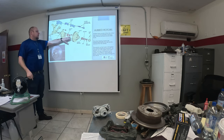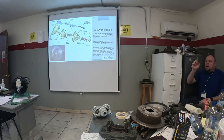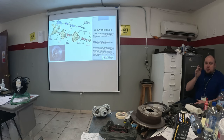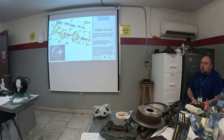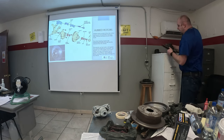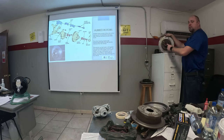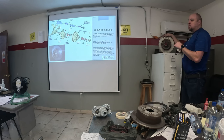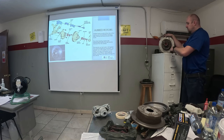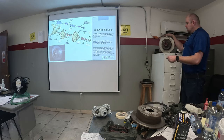Then you take it to the parts washer, remove all the old grease, and inspect the bearings. Here's an ASE question: what if only one roller on one of these bearings was damaged? You replace the whole thing — not just the bearing. There's also a race you can't see in here — the other half of the bearing. These pieces are machine-matched. If you replace the bearing, you've got to replace this race too. You'd need a punch, or better yet a brass drift, to knock it out.